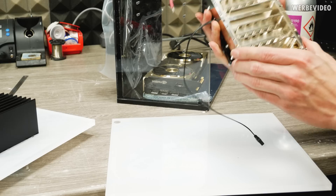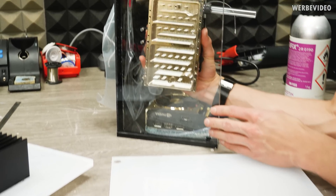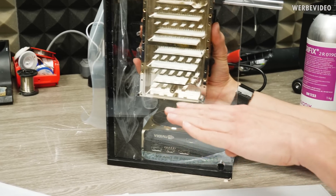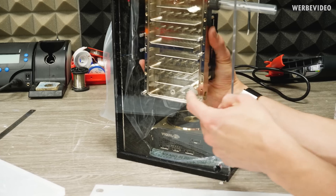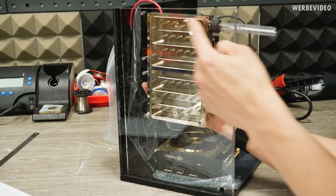Basically we're cooling the Peltier element with the water block, trying to bring this surface down to maybe 10 degrees Celsius total temperature. This will be mounted from the inside, and we will have an O-ring to seal it off. The gas can then access through a hole and travel up inside this structure all the way to the top.